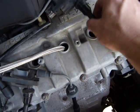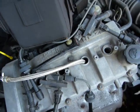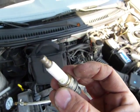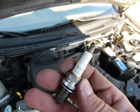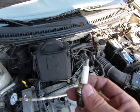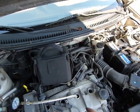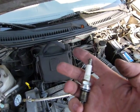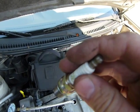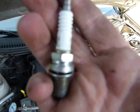I have removed the spark plugs from these four holes here — one, two, three, and there's the fourth one. What you're looking for is oily spark plugs. If it's dripping with oil, basically don't even test for compression — just flee, don't look back. That means there's oil in the upper part of the engine where there's electrical wiring and where there shouldn't be any oil. But these spark plugs look dry enough.